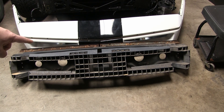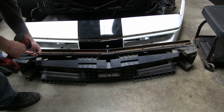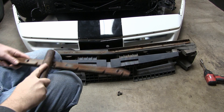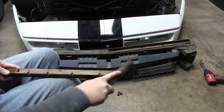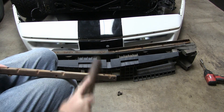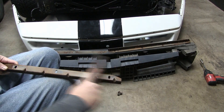The impact bar is the next thing I'm going to be working on. I'm really not too enthused to do it but I'm going to clean this up, and also that bracket on top that's starting to rust — I'm going to take care of that so it doesn't get any worse. I'm going to give all this rusted area just kind of a fast rub down with a wire brush. I'm not going to go overboard on it — I'll be using a rust converting paint. There'll probably be little areas I would almost never be able to get into, but I'll just give it a fast brush down, anything loose on the surface.